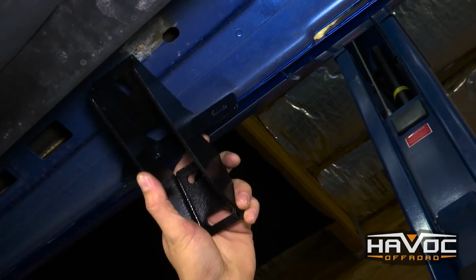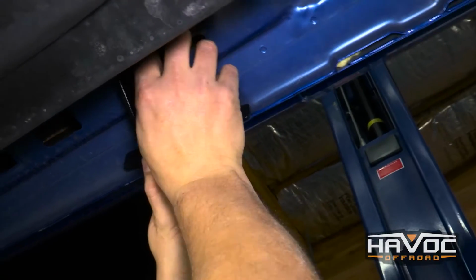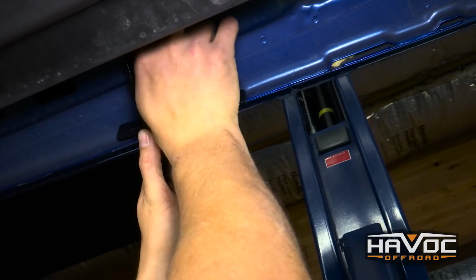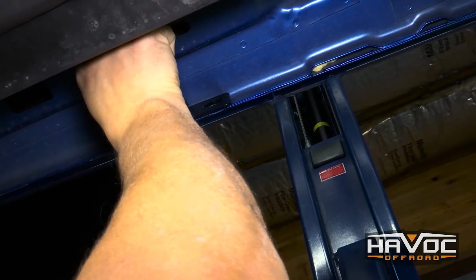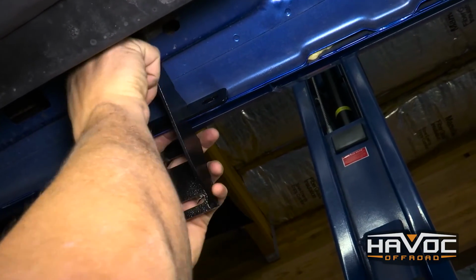Now we'll go ahead and put our middle bracket on, same way we did that bracket. And I misspoke earlier, it's actually 20 foot-pound of torque, so I may need to loosen that one in the back because the magic arm might have over-torqued it.